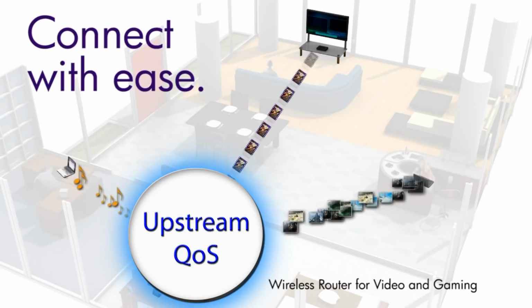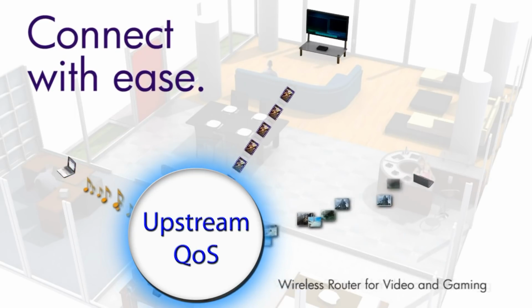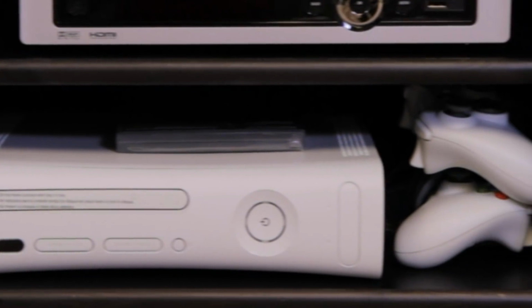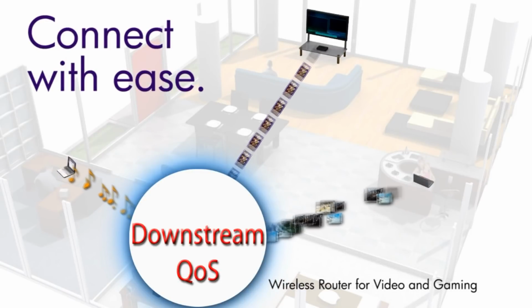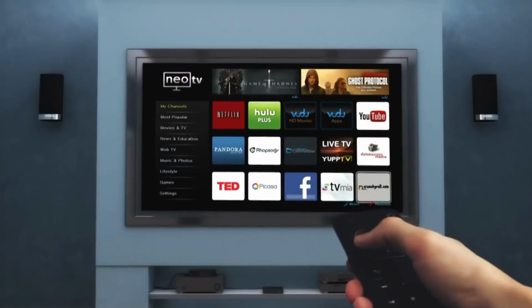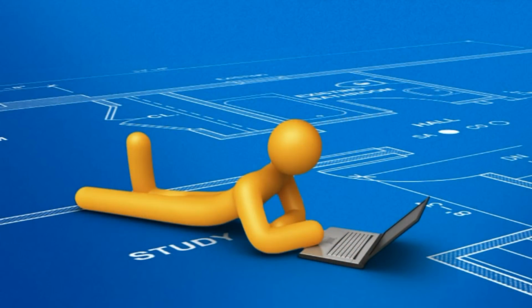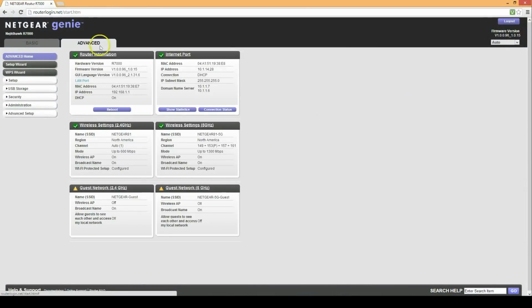It prioritizes internet traffic from local devices to the internet. Upstream QoS should be set up if you have a game console like an Xbox and you'd like to enjoy lag-free online gaming. Downstream QoS is streaming QoS. It prioritizes traffic from the internet to your network. This should be set up if you like to stream internet video such as YouTube or Netflix. Setting up these features is very easy and can greatly improve the performance of your network if you like to game or stream.